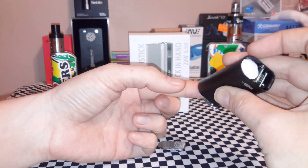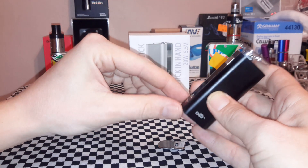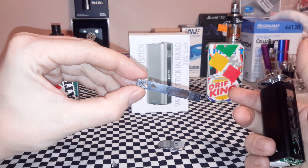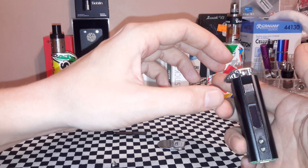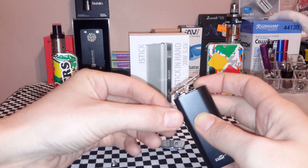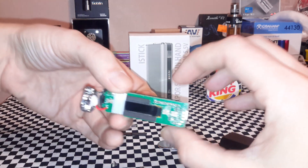There's no way it can come out without the buttons, so you need to pull this front face plate off. It's just plastic — don't pry it too much or you will crease it, it's just glued down. Once that's off the buttons immediately fall out. Now there's a little tiny one on the top — that one comes out, the main button will fall out, and then the whole unit can slide out from the top just like that.